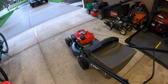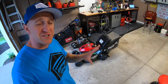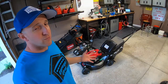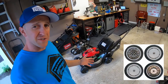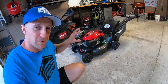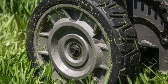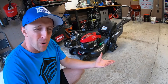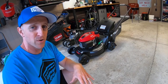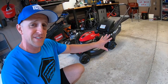This thing moves so easy now, it's unbelievable — it just wants to keep going. Now ladies and gentlemen, this is a procedure that I've been doing for many, many years on many, many mowers. I really don't find myself purchasing wheels for a lot of mowers because I do these steps year after year. Now some people like to tell me that this will become a grass magnet on the inside of the wheels. Well, if you lay it on thin, you should be fine. Some grass might get stuck on there, but this is one of those procedures that I do year after year as I winterize my mowers — I'll take the wheels off, clean all the bad grease off, put new grease on, and they're set for the next season.